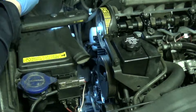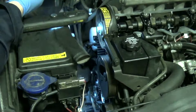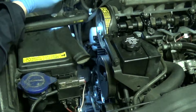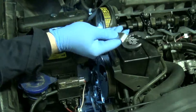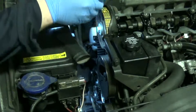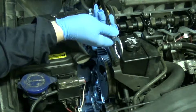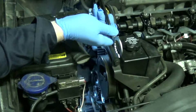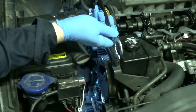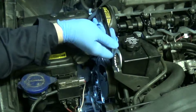It's not the easiest tensioner to get in the right spot, so you need to use your tensioner spanner almost as a counter-hold. Once you've put the tensioner into the belt and measured it with the feeler gauges, you then need to start doing up the tensioner bolt. But as you do that, there is actually a tendency for the tensioner to tighten even further, so you need to hold it back with the tensioner spanner.